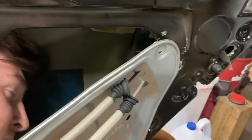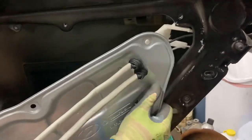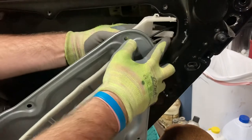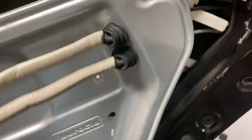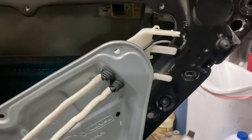The cables and the little white brackets in the back have some screws on them. One's got a little pry clip, then you find screws. Here's the new one — there are two screws right there on the ends. The screw head is facing towards the door skin, towards the painted outer side of the car. It clips up top as well, and there's an access panel you have to get through. That was the most aggravating part — messing with it for 30 minutes to an hour.